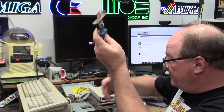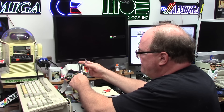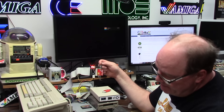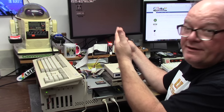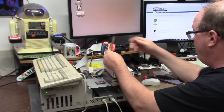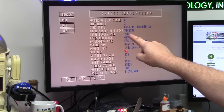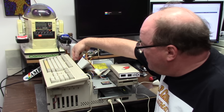This 4-gig was my original card. I'm going to plug this into — it's keyed, this needs bus power, so I'm going to split it — I have a P6/P7 Berg splitter. Let's see what happens with this using IDE. Maybe my hard drive light will actually work. Yeah, I saw the blip and it's booting — my hard drive light does function. So there it is. That's using my card on the IDE internal. Speed test on this disc — 6.5 meg per second, 300 buffers, LIDE.device — you can see right there.